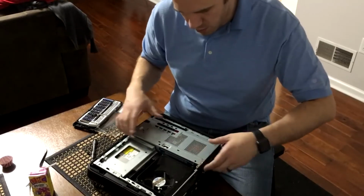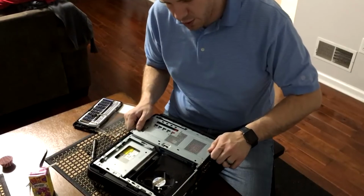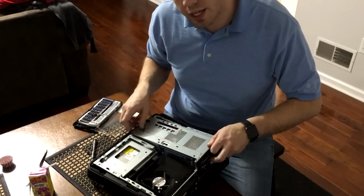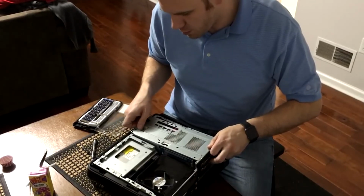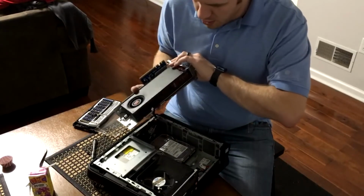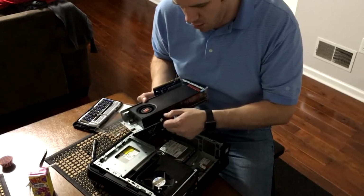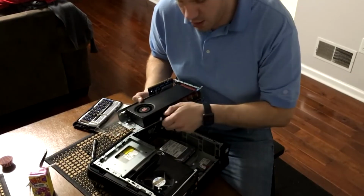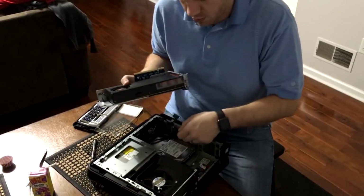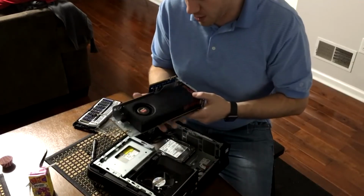What you do next is you literally pull it up. So you just grab anywhere and you just pull the front and the back up evenly. You might have to wiggle it a little bit here because again the riser card's stuck in. And once you pull this up evenly, on the back side, you'll have your power cable. There's a little clip here, undo the clip, wiggle it out, and this does take a little bit of force, and that'll do it. Now it does give you 2, so that gives you a little bit of options when you upgrade. Now you have the card.